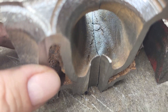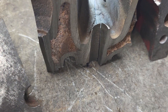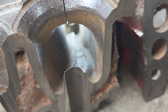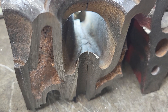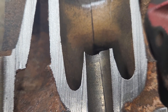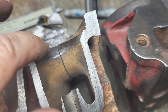We can see right down the port — they have this angled over to the side. I think they were trying to force air towards the center more, because a lot of air likes to follow the straight wall — that's why we always dyke them on that side. It's actually an interesting view of the shape of the port. Completely stock, these have a really good short side radius — laid back a little bit, nice and tall. These don't have a stock valve job; they've had some kind of work at some point with more than one angle, but nothing past the valve job.